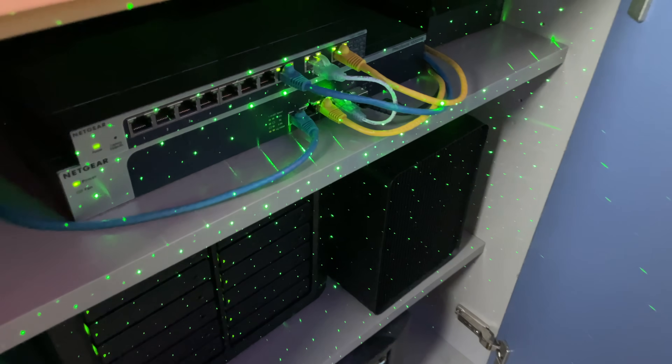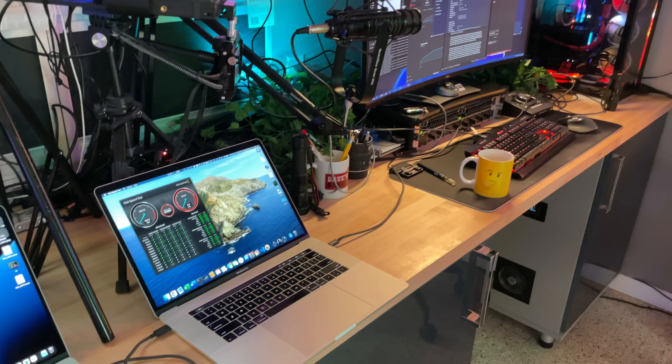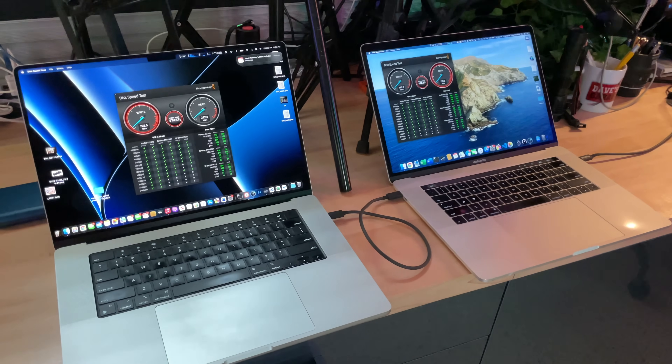When you need only two 10 gigabit ports as I did, I recommend the Netgear ProSafe switch — at $99 back when I bought it, it's a switch with two 10 gigabit RJ45 ports and several standard gigabit ports. I used it as an uplink switch to my MikroTik, which has the extra SFP Plus ports. Out here in the shop I have three devices running at 10 gigabits: my Mac Studio with an external 10 gigabit Thunderbolt adapter, my 3970X PC with a 10 gigabit card, and the Synology 12B NAS. I was experiencing data corruption at high load on the Synology using a 10 gigabit card, so I threw in a cheap aftermarket card instead. One of the easiest ways to connect any two modern computers is via Thunderbolt — here I have my Threadripper connected by Thunderbolt 3 to a MacBook Pro, which in turn is daisy-chained to a second MacBook Pro.